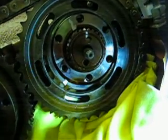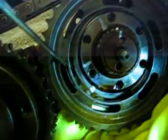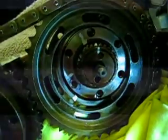So I'm going to have to relieve some pressure in this timing chain from down here. There's this little brass bolt right here. I believe that is for a timing chain tensioner. If I undo that bolt, I think it'll relieve enough tension on this chain so I can move everything back over and then put in all my new 6 bolts and put everything back together.